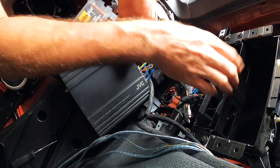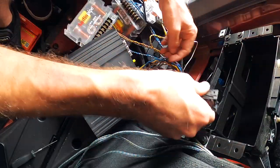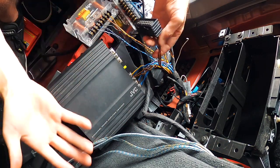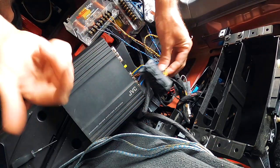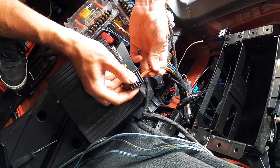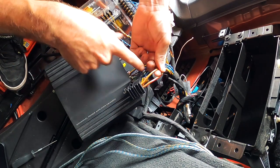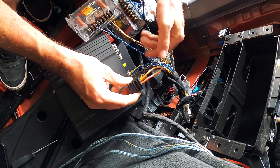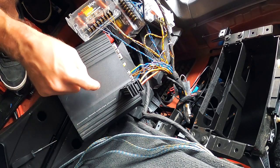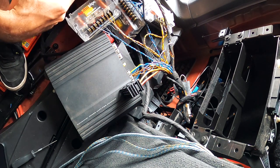I've removed the other couple of modules — the navigation drive and something else — and I'm starting to work out how to position all the amps in there. If I can get away without extending the sub speaker wires I'd like to, just to keep extra wire in here as short as possible. Something else has crossed my mind: the aftermarket amp has a 20 amp fuse and the DSP fuse in the car is a 30 amp fuse, so by my maths I should be able to use the factory wiring to power this amp. We've got ground, positive, and a remote wire. I'm going to use the DSP power wires to power the subwoofer amp and then use new wiring to power the high channel amp.